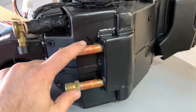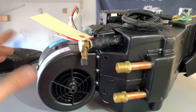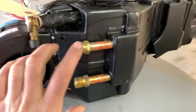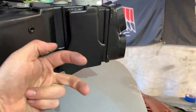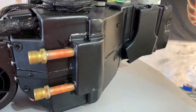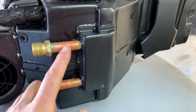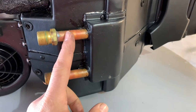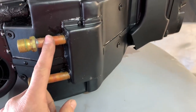These are the lines that actually operate the heater core. They give you adapter fittings, the o-rings, you put the barbs on it, then the hoses come out here. Your kick panel is right here and you can shoot up inside the dash. I'm not going to do that. We're actually going to make these things do like a 180, run back this way, then poke through the firewall right about here in the factory location. These are half-inch copper pipe, pretty standard for households, so I've got some ideas to make this work.